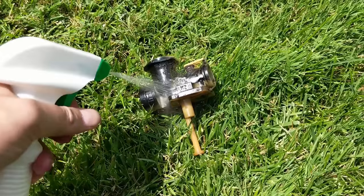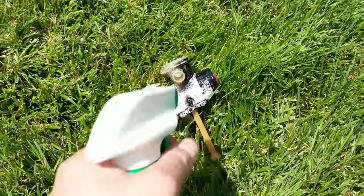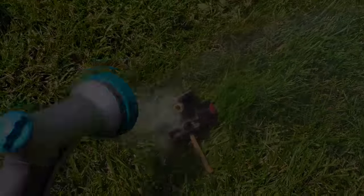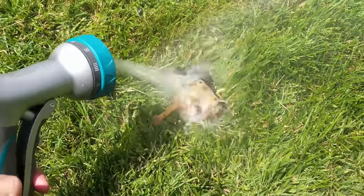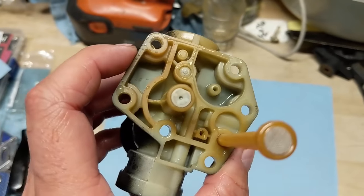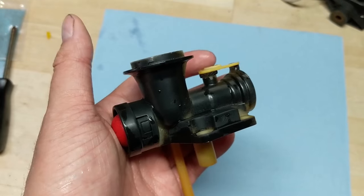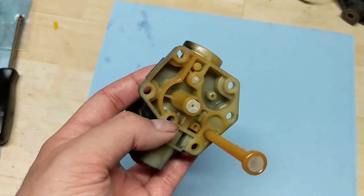Even though I have an ultrasonic cleaner, I have a little spray bottle of Spray Nine here and I'm just going to douse this carburetor as best I can. You don't have to use Spray Nine but this stuff works pretty awesome. I'm going to take my garden hose set to a fairly aggressive spray and blast this thing. The big thing is you want to get all of the holes and ports in the bottom of the carburetor — aim the nozzle directly in there, shoot water through the main jet, shoot some water through that screen pickup, and spray the brass jet in there and force the water through. If you have a compressor I would suggest blowing out all of these holes to make sure they're clean and free of debris, which will also help dry your carburetor off.